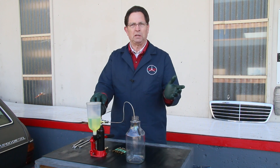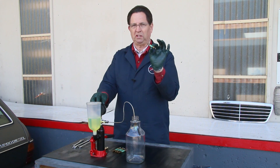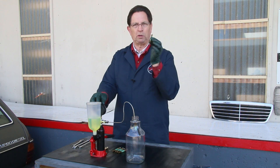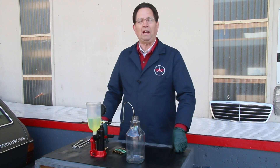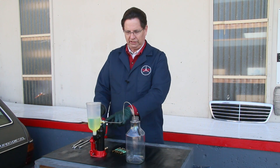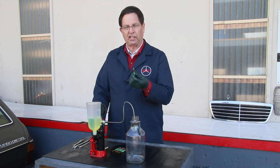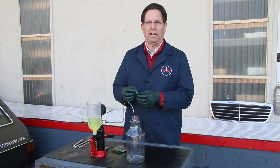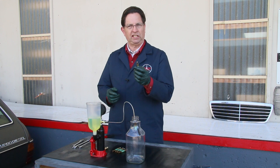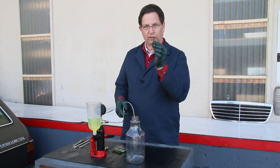The procedure is totally different from diesel because these are not adjustable. Diesel fuel injectors can have their pressures adjusted and you can get inside them to clean them — not so with these. These are sealed, you can't get inside them, there are no repair parts and they are not adjustable. The early-style injectors have larger threads that fit right on our normal fitting, same as the diesel fuel injector, but on the later injectors — late-model 560, 420 V8s and the 104 engines — you need an adapter fitting for the finer threads.